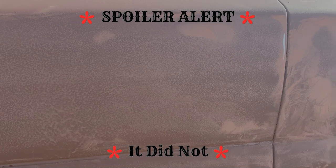While the weather was cold, I did come back and get some practice on some wet sanding. It's not perfect, because I started burning through the paint in some areas, so I didn't want to go too deep. But I did knock down some of that orange peel, and it should give me a little bit of a better finish to work with at the end.